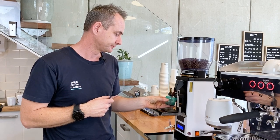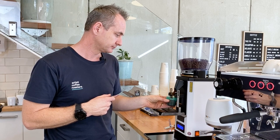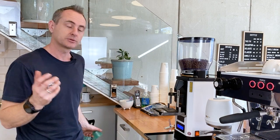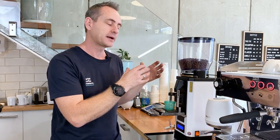This makes it a lot easier when we get in to clean the blades. And it also helps you to know that it's only 2 dosing pots, and that's usually set for us at 22 grams. So it's about 44, 45 grams of coffee that is held in that whole section, which is really quite small in comparison to a lot of grinders out there. So now we know that that shoots clean, we can start to look inside this grinder and remove the hopper and start cleaning from the top down.